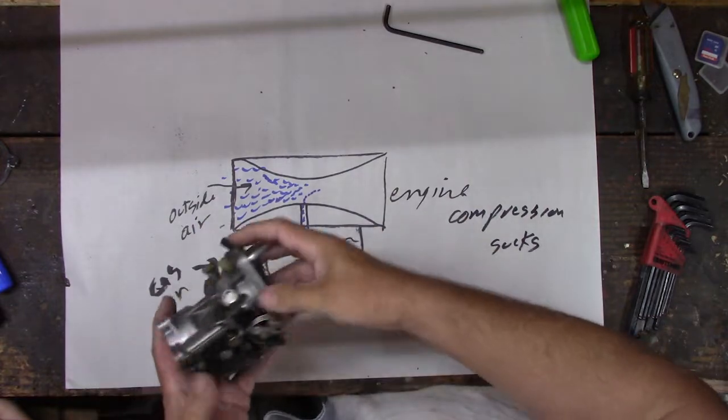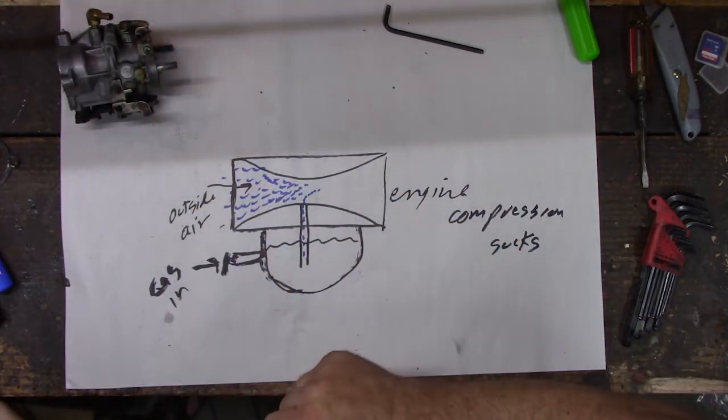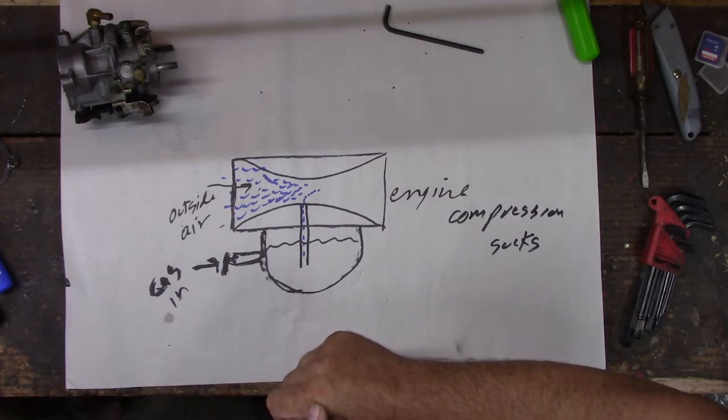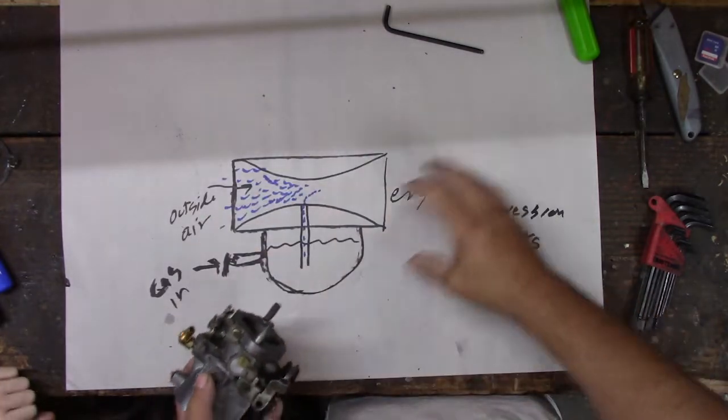There's a couple other things that could cause this. One of the things that could be a problem is we have the wrong exhaust on the bike. It could be the wrong size jet, because if there's too much back pressure, it probably won't run. Remember how it had those straight pipes? Not enough back pressure can cause it too. That changes how the engine works.